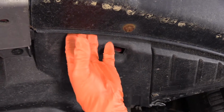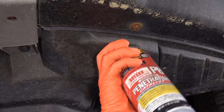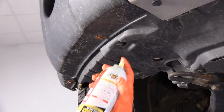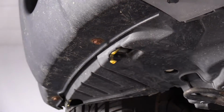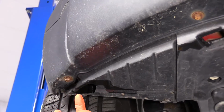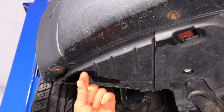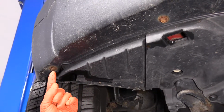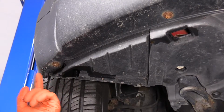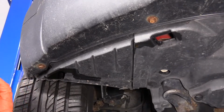And this one I think is spinning in place. I'm gonna come over here, get these ready. So at this point we try to remove these little bolts holding. They're metal clips with welded nuts on them that hold the plastic down, and they're so rusted that the nut has broken off on the metal clip. So all 4 metal bolts, 2 on that side, 2 on this side, are just spinning in place.